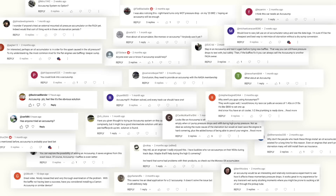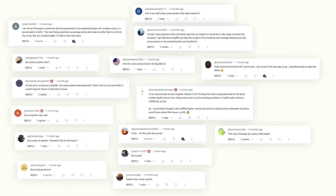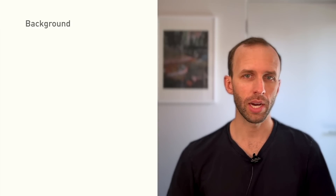After our last test was unsuccessful, we needed to take a step back to figure out what to do next. If you look at the comments from my first two videos on this topic, you'll see two very common suggestions: add an accumulator or do a dry sump conversion. Many go as far as to claim there is no solution short of a dry sump. These are good suggestions, and a dry sump would almost certainly solve the issue, but there are a number of reasons why I think it makes sense to first try to find or develop a baffle that can solve this issue, at least on low grip tires.